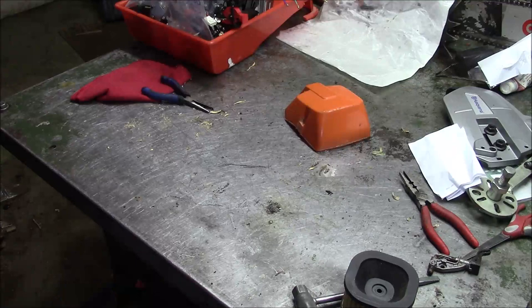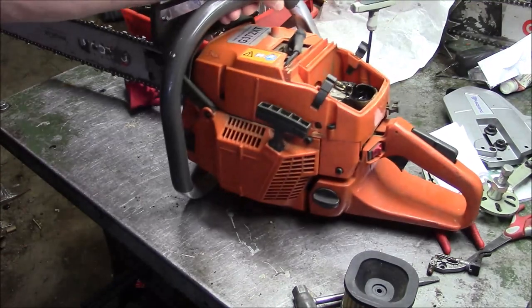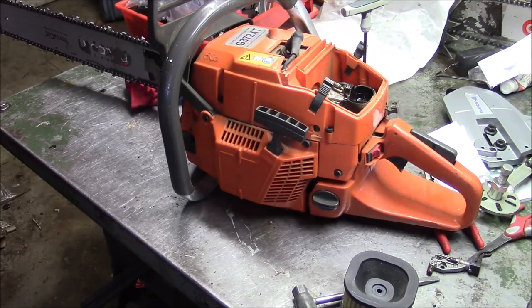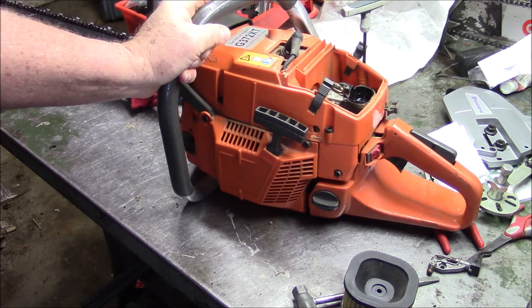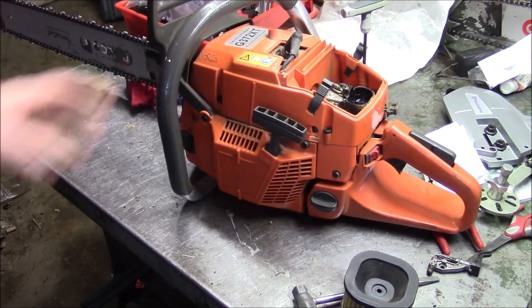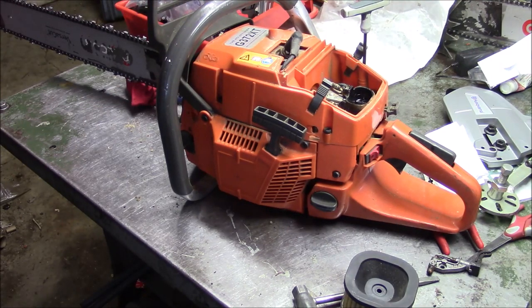Pretty much the same thing I would do to a standard X-Torque to turn it into a little bit snappier work saw. And the reason I started doing those intakes was I found that it got rid of that pooling of the gas in the intake boot that the standard X-Torques had for a while. They've beat that now, but in the beginning they had problems with idling and things like that. And after I'd done that intake mod to them, they ran stronger